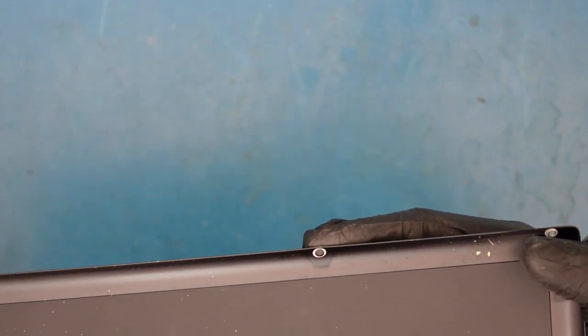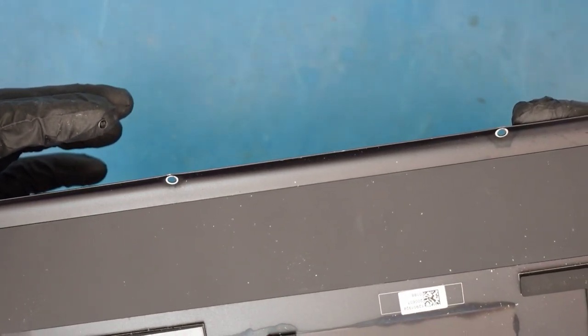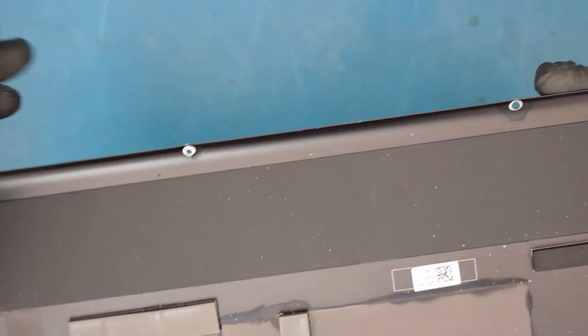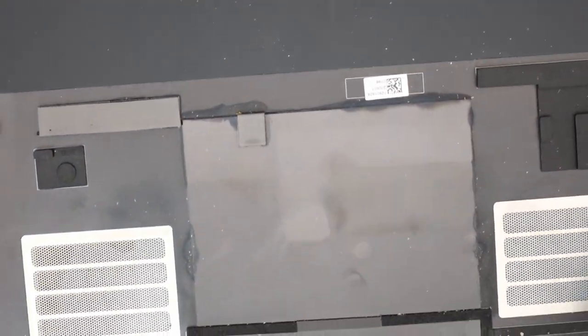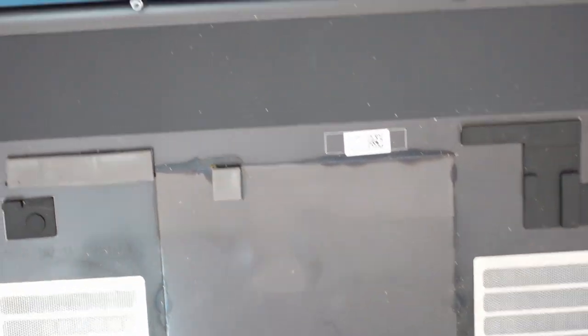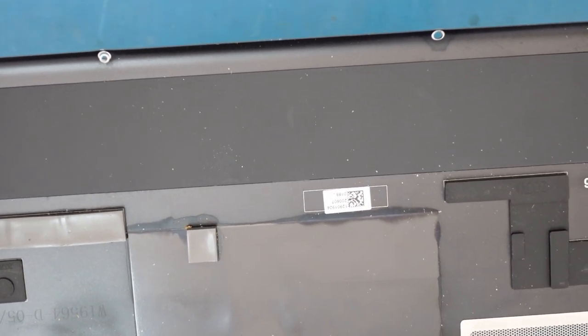This one over here doesn't have one — it fell out because the battery was expanded. So you can do two things: you could see if you can find something to hold it in, or a better way is probably to just get a slightly bigger screw than what was typically in there, which will hold a little bit better. See how loose that is with just my fingers? It's falling through. When batteries expand, that can happen, so you may need a slightly bigger screw, or you can hold it in place and put a screw through it and that should work fine too.